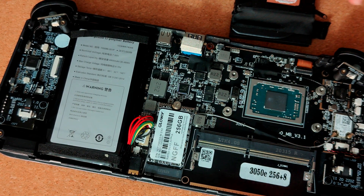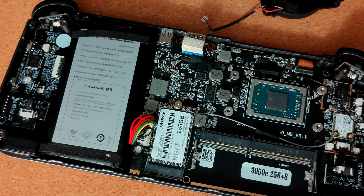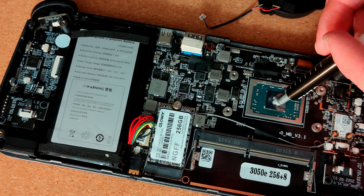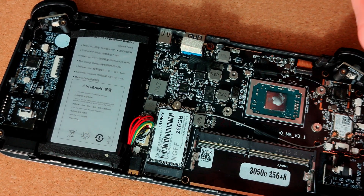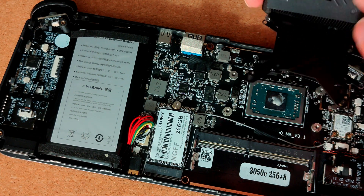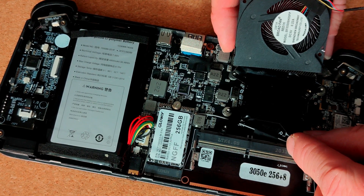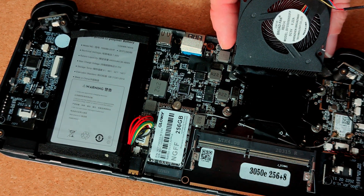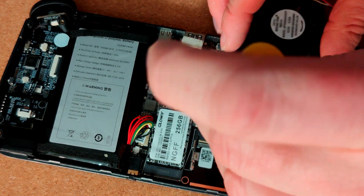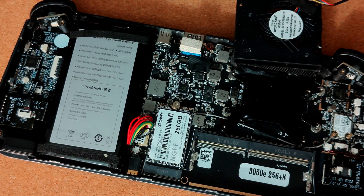Now onto the heat sink, which actually had a pretty good bond but is again absolutely rock hard. I've cleaned it off and now I'm applying TM-30 - a nice little pea-sized blob in the middle, press down and pull away to the side, leaving a nice blob. I want minimum thermal paste going over the sides. This is probably the riskiest bit of any work on the Anbernic Win600; changing the memory or the SSD is a piece of cake by comparison. Arctic Silver would be better, but TM-30 will do - this isn't exactly a hot-running chip.